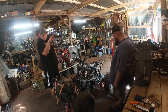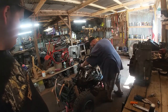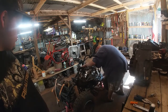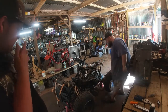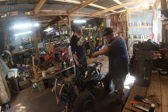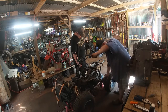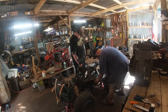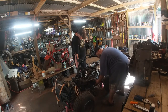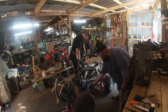You know, we checked direction. Uh-oh, wait a minute. Is this forward or reverse? That's neutral. No, that's forward right there. Okay, good. So to go forward, the motor's going to need to turn that direction. To go reverse, that's right. Forward. That's reverse. Go forward now. Ready, forward? Okay, so we're in good shape. We did check motor direction, and the motor needs to turn this way.